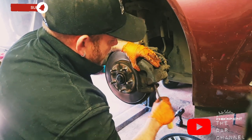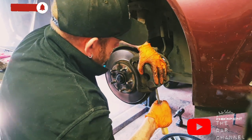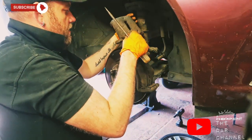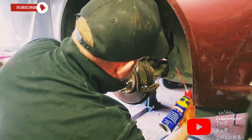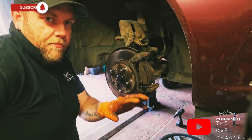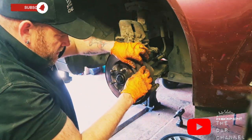And what I tend to do is get the first brake pad out. Always can be stubborn now. What I do first of all, get the brake pad out. Just need one of them out, and then it means you can press the caliper back just using your screwdriver.